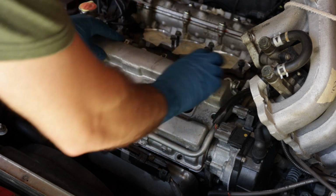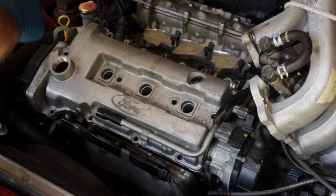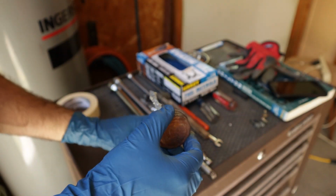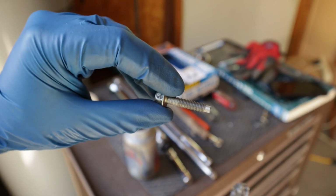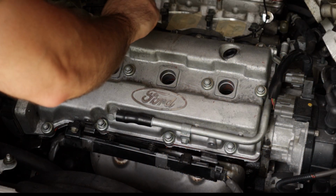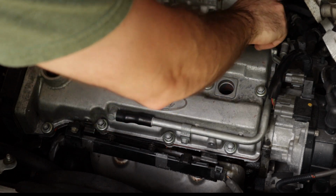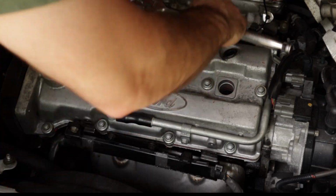Insert your new washers and grommets into the appropriate holes. As I mentioned previously, the bolts along the middle of the valve cover are longer and thus accept the longer grommets. Take the bolts from your cardboard diagram and apply a small amount of anti-seize lubricant to each bolt. Then, hand screw them into the appropriate holes following the mirrored S-shaped pattern indicated by the numbers that we wrote earlier. After you've screwed them all in by hand, attach your socket wrench and short extension.